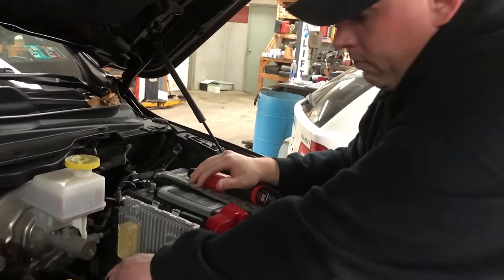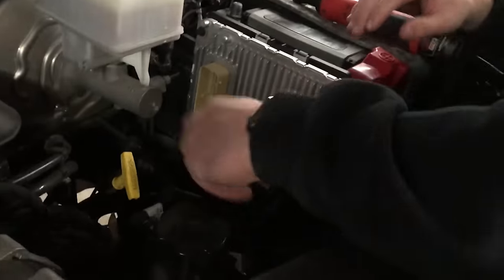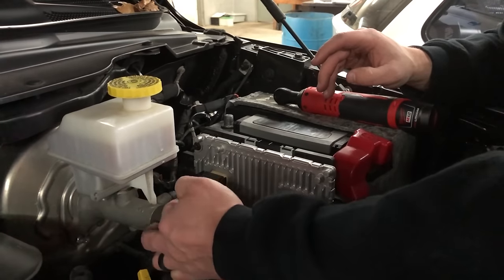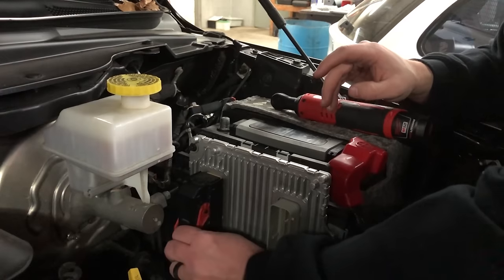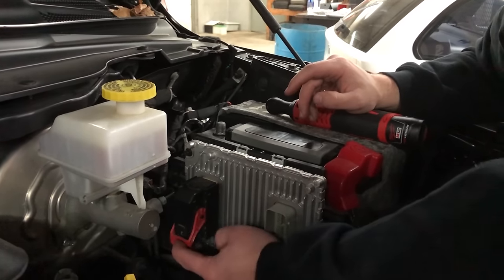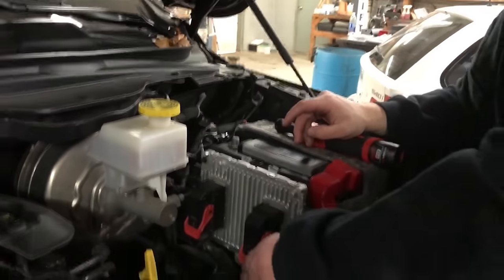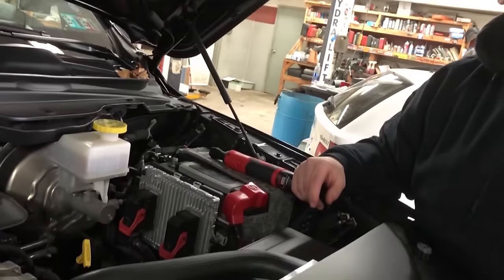It's all bolted back up. Like I was telling you earlier, guys, if you can see these, they're color-coded. We'll start with our tan one. We're just gonna put it in there, start it, and then slowly push at the same time, but not hard, and then the lever will take it in the rest of the way. And unfortunately, there's little locking tabs that slide down to lock the red lever down. These broke off. And slide it down. Our unlocked DiabloSport PCM is now installed.